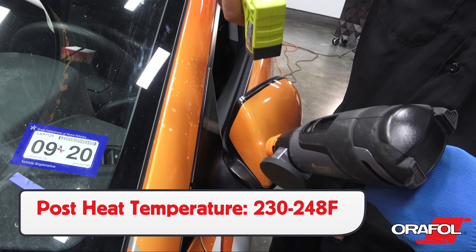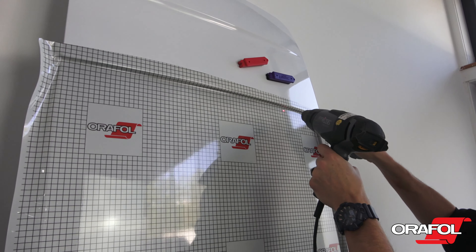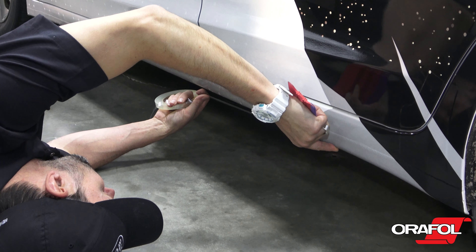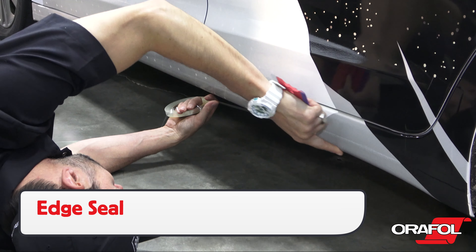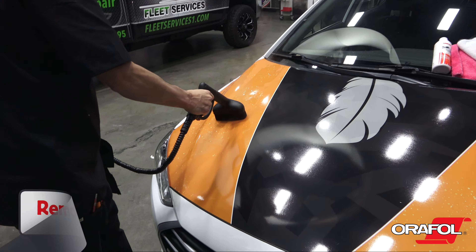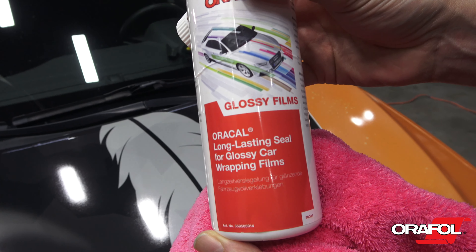Release the entire liner around the recessed area and bridge the film over the gap with even tension. Once set, squeegee the flat section in the recessed area to hold the film in place. Put on an Orafol wrap glove and wet if necessary, then apply generous heat to the film in order to soften it, then form the film in to the deepest part first. Be sure to keep the film warm during this process. Once a run is formed in, squeegee the flat section down.